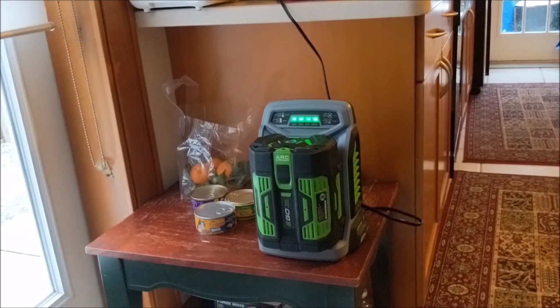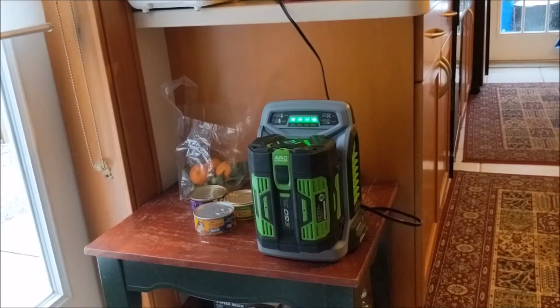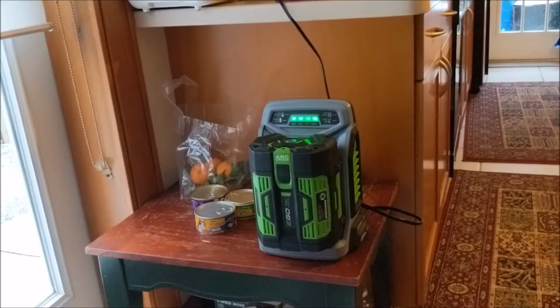And if you don't fully charge every time, if you charge, let's say, to 80%, use down to 60, and so on several times, that will prolong the battery life even further. You can double it for some chemistries.